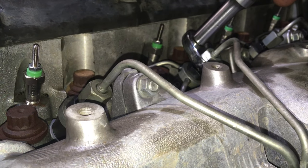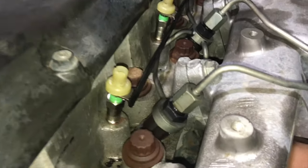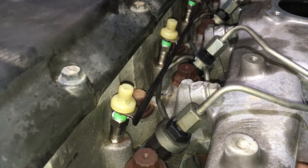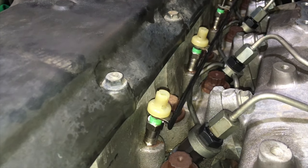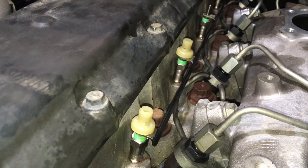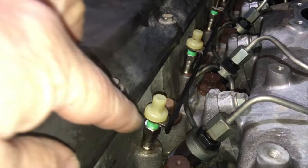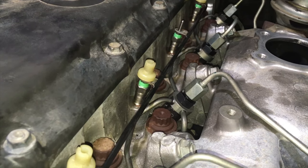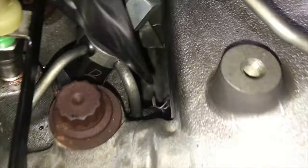With fuel lines all torqued up, the glow plug rail goes back on top. For the rail nuts, the torque setting is very low — around 4, 5, or 6 Nm. Some glow plugs can crack the insulation if over-tightened. I prefer to use a hand screwdriver-type tool with a 10 mil socket — just nip it nicely, very light pressure, then the red caps push on and hand-tighten. Don't forget to refit the fuel return hose line.